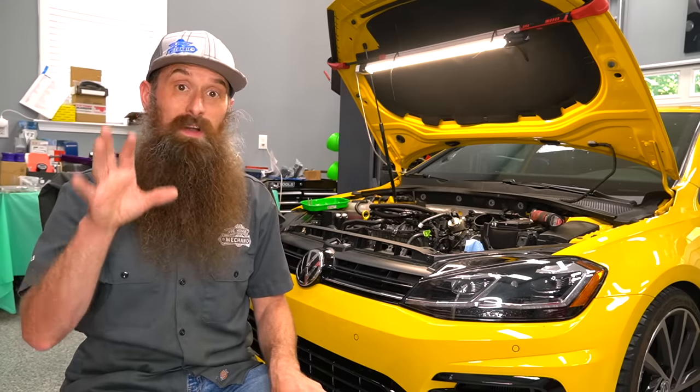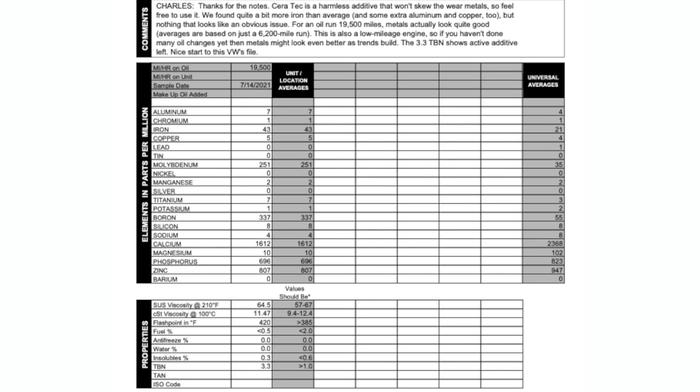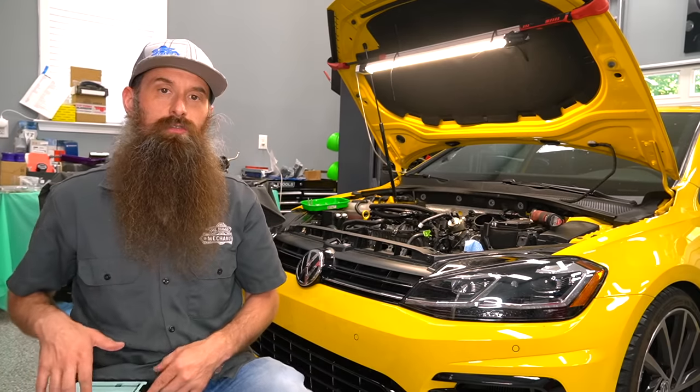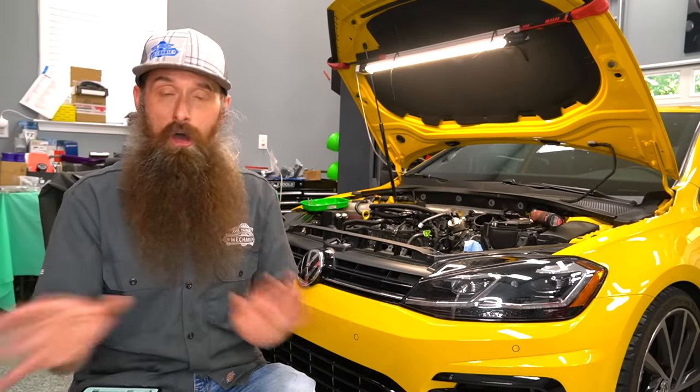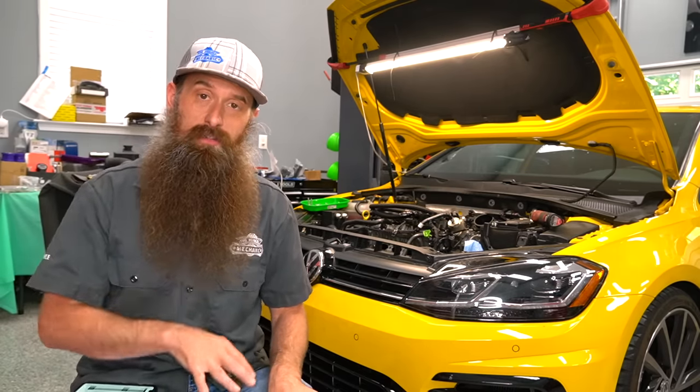When I changed the oil at 20,000 miles, I went ahead and sent a sample of the engine oil to Blackstone as well. This was 0W-30 — I'm pretty sure it was Castrol — and we also added Liqui-Moly Ceratec when I did the oil change. Blackstone said Ceratec is a harmless additive that won't skew wear metals, so feel free to use it. They found quite a bit more iron than average and some extra aluminum and copper too, but nothing that looks like an obvious issue. Metals actually look quite good. Average is based on 6,200 miles, and this was a low-mile engine, so the metals might look even better as a nice start to this VW file. Basically there may still be some lingering stuff from when the engine was first built, but all in all we have really nothing to worry about according to Blackstone Labs.